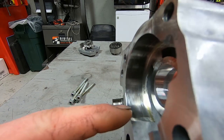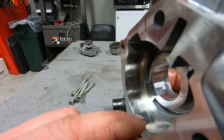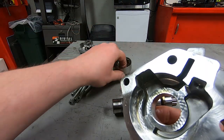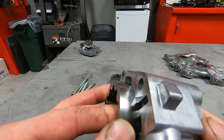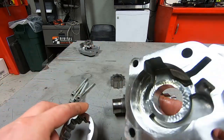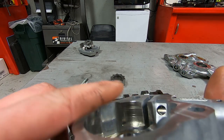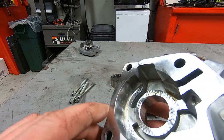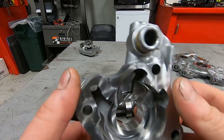There's a dark spot there, and it looks like it wasn't touching in certain areas. It's supposed to be gliding on a film of oil so it isn't really supposed to be touching anyways, but it's kind of weird. There are a few grooves in there like it picked up some trash. This is the scavenge pump, and I'd say that's a little unusual for 7,000 miles.